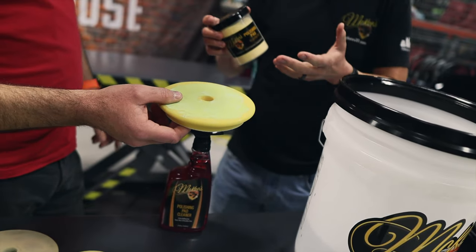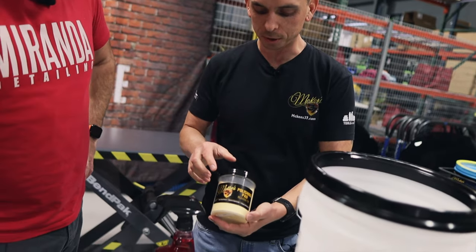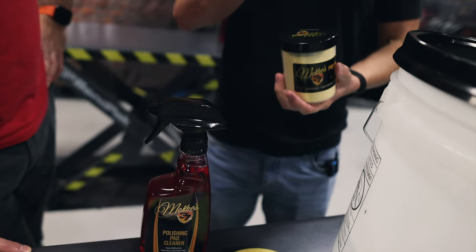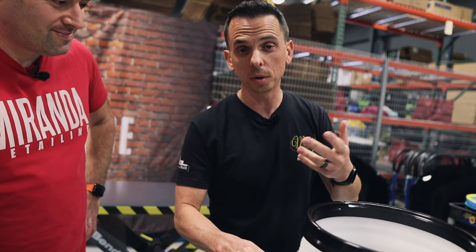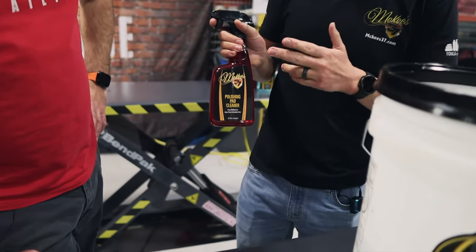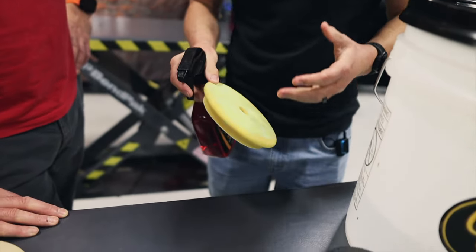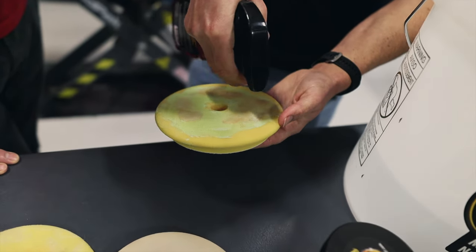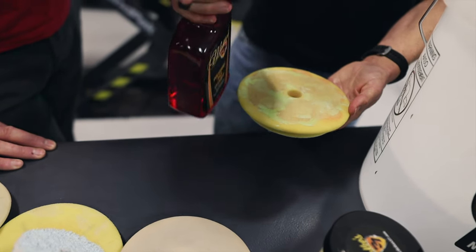Let's show you how to really deep clean your pads with some of the McKees products. When you're detailing a car you're going to use a lot of pads. An option if you don't have a pad washer is the McKees Polishing Pad Rejuvenator — this is citrus-based, all natural, orange degreaser. You put a scoop of this in a bucket and let the pads soak throughout the day. When you're finished with the pads they rinse out really easily. If you're not using a lot of pads or you're not a professional detailer, we have our spray — one of our best sellers. It's very powerful and it's designed to break up the spent residue, the silicone oils, any solvents, and the abrasive powder.